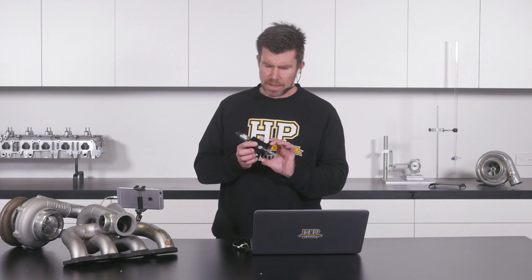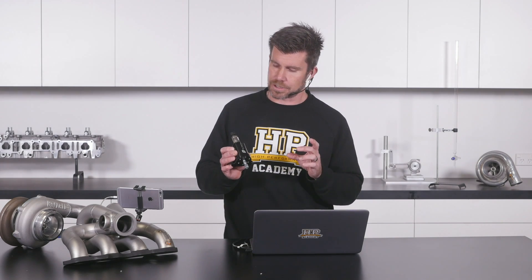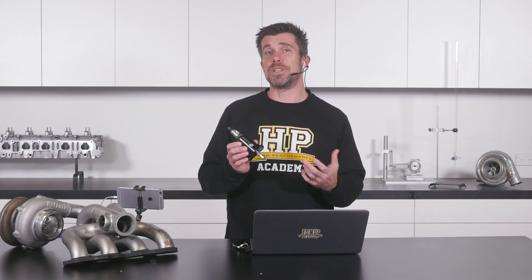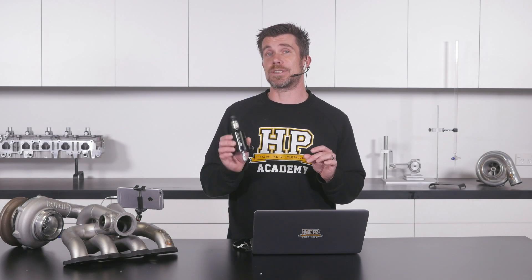This brings up the problem of how we actually measure our exhaust gas back pressure, because we're talking about a fairly harsh environment in the exhaust manifold or turbo exhaust housing. That doesn't stand up well if we fit a sensor directly into that area. So instead we use a remote-mounted sensor. This is one of the exhaust manifold back pressure sensors going on our FD RX7 — this canister is a product made by Full Function Engineering. It's a damper to take out some of the spiking nature of the pulsing we generally see in our exhaust back pressure trace, with a 150 PSI Honeywell sensor fitted to it.